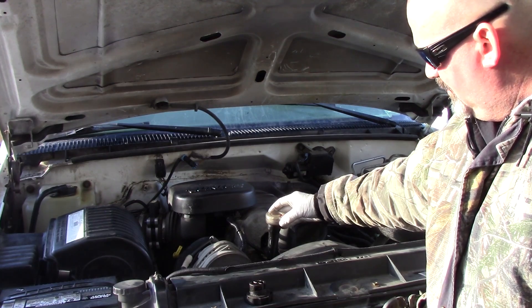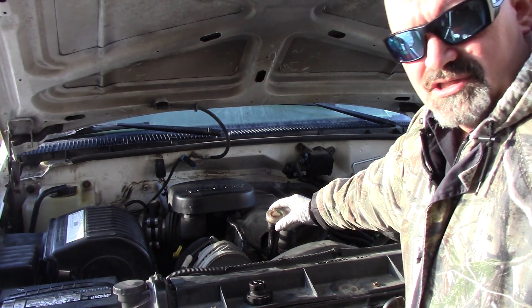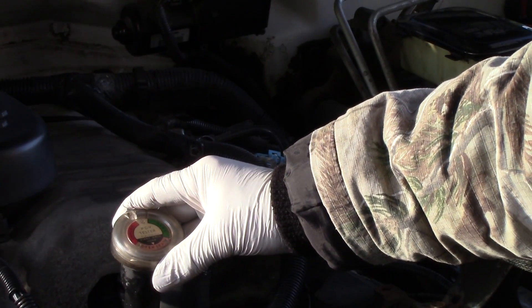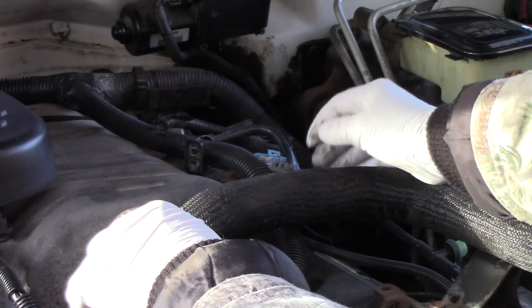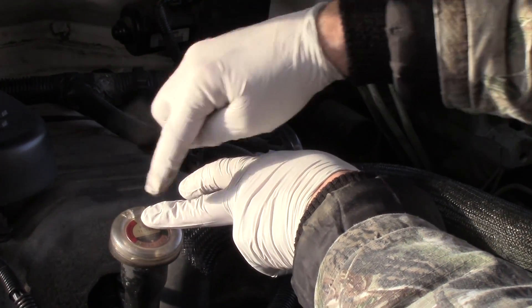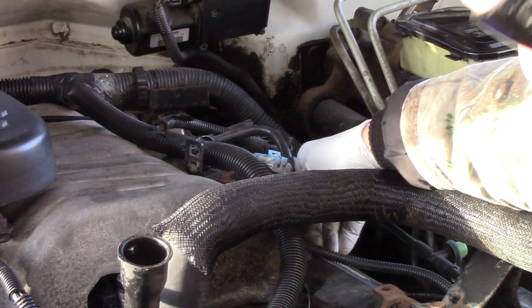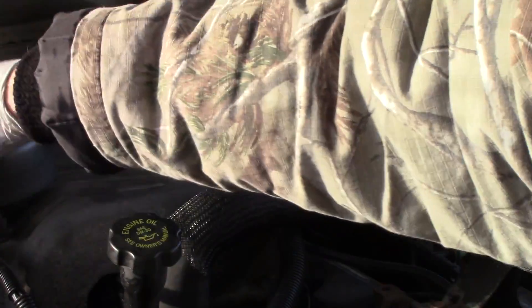With the vacuum tester oriented properly, you can see it doesn't have the best PCV vacuum — the ball moves a little bit. Then if we remove the PCV valve, it moves slightly. So there is a little bit of vacuum getting into the crankcase, but I don't think that's causing the misfire. I also noticed a very strong fuel smell in the intake when I had the air cleaner off the throttle body.